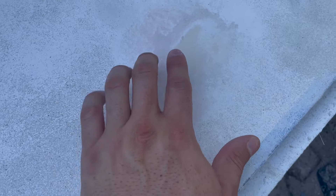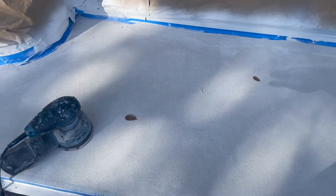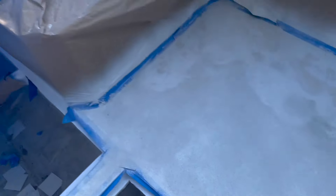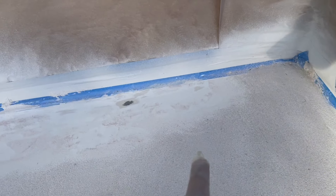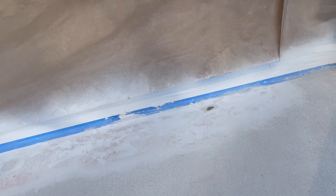Now what I'm going to do today is go over it with some fresh gel coat and add some new sand particles. What I recommend you guys do, if you're going to tackle this project, is go one piece first, another piece second, and then the ones up in the front. Do it piece by piece — it's a lot easier. I sanded everything down as best as I could, and we're going to reapply gel coat in this area first and then spread the non-skid.